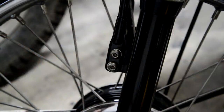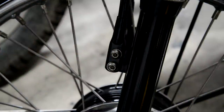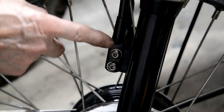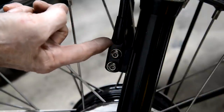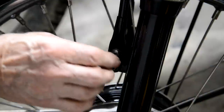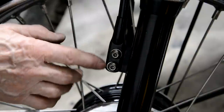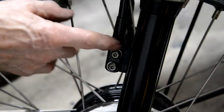Right, well, mudguard stays are tube, generally. Now, this is the C15, and these have got ends on them. The ends actually are made of tube, which slides over that. But if you just trap the ends in the vise, you not only get a nasty square end, but also what tends to happen is they'll squish up to one side. Whereas here, the flat piece is nicely in the middle when you look down this line, if you were looking from the front. If you just squish them up in the vise or in a press or whatever, they always look nasty.